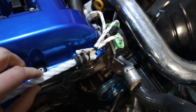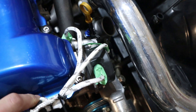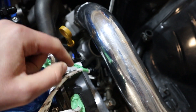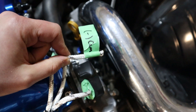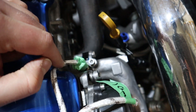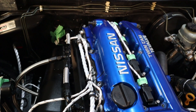The main branch continues along and I found nice spots to clamp it — not too much tension, I've left a little bit of slack, which is important. Then you get to the final two sensors. I've got my cam sensor, which is on pretty much every SR engine. I've got a ground point there — I'm still researching whether to ground the cam sensor to the chassis or engine rather than the ECU. And then the last one is the ECT sensor — the coolant temperature sensor — which I moved over here because I completely changed the coolant system in previous videos. That's the main harness that runs the engine.